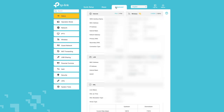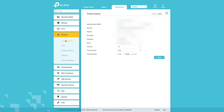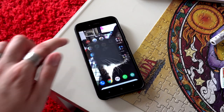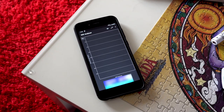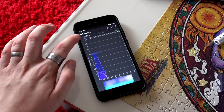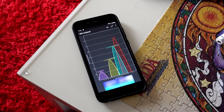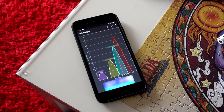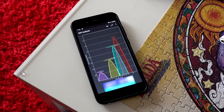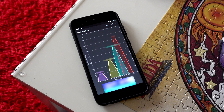What channel do you want to change it to? You could just pick one at random, but that's an unmitigatedly terrible idea. Instead, download a Wi-Fi scanner app on your phone — there's a good free one on Android linked in the description; on iOS you can find something suitable. When you load it up, it'll scan the air for every single Wi-Fi signal, even those without SSIDs, and show you what channel they're on. Just like life, you want to avoid everyone else — find a gap that no one's using and pick that number. Bingo bango!